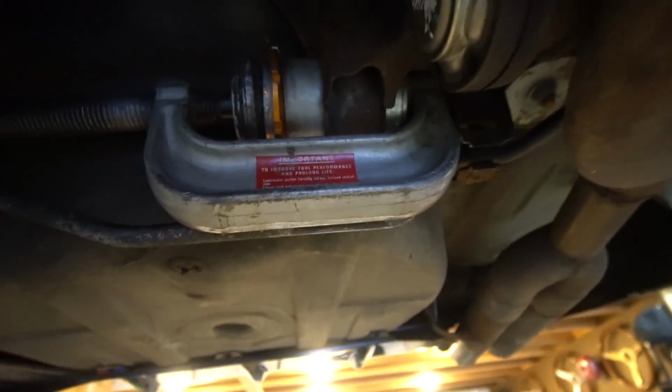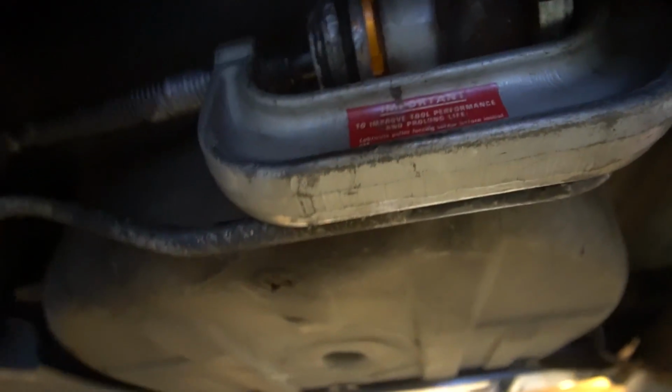All right, I got the new bushing in there. Got one of the max speeding rod adjusters sitting up there as a spacer. And this is just a ball joint press tool. And just rotate it and press it in. It's like a giant C-clamp, just with a much stronger piece of threaded section. And it's working out great. So, all right, that worked out awesome.